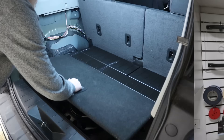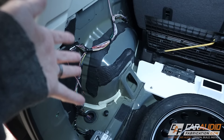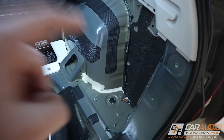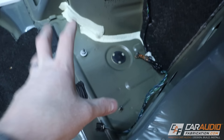I want to start with tackling the back of the Equinox. The subwoofer I'm going to be using will be in the OEM location, but it's not going to be the stock subwoofer — I'm doing something a little different. I obviously have all the trim removed already from installing the amplifiers in the previous video. Now I need to make sure this surface is nice and clean. Cleaning the surface is very important — you don't want any dirt or oils on it, or it's going to prevent maximum adhesion for our sound treatment.